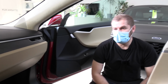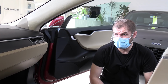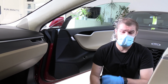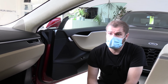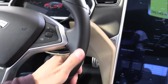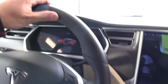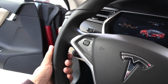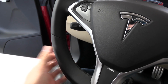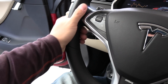Like I said, we kept it environmentally friendly, and we used products in areas where it's necessary. There was a few step process. We applied a grease remover first to get rid of all the schmutz. Schmutz, yeah. And then we followed with primer and fillers to fill up the scratches. And then it's just been resprayed with the Tesla color coat that matches the steering wheel.